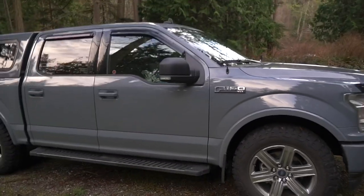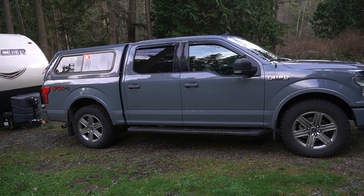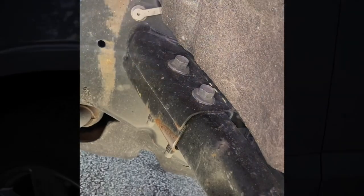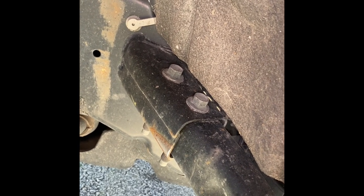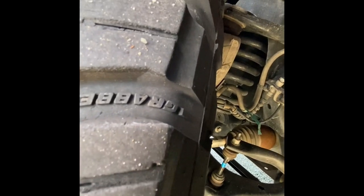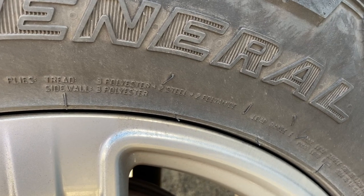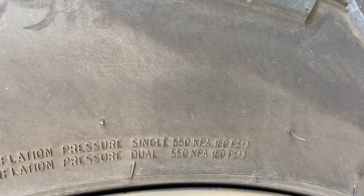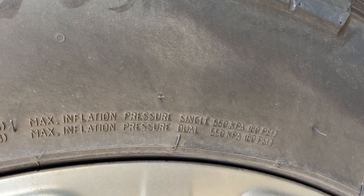The truck looks amazing — good stance, great tire size. The only issue in the wheel arches is on the driver's side crash bar: it only rubs when reversing, not when driving forward, and the tires are not worn on the inner edge from hitting that bar. There are 10 plies — seven on the tire body and three on the sidewall. One thing I noticed is that this tire can take 80 psi cold loaded pressure, which I didn't know before; I think I'll raise the pressures when towing.